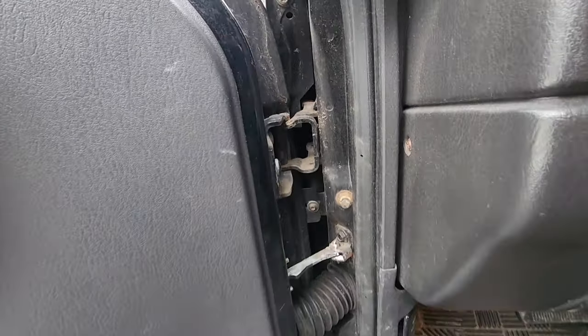There we go. She starts right up, but as you can hear, yep, it's got a little tapping. Doesn't sound great. I'm not quite sure if it's tapping like a lifter tapping or a knock, like a rod knock, or a piston slap. Haven't yet determined it. Gotta keep an eye on it. But it gradually, over time, became a little worse, so it's not the connecting rod bearings. It's something else, but I think we're just gonna let this baby ride until something catastrophic happens.